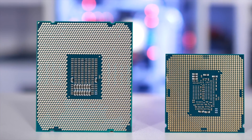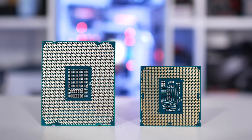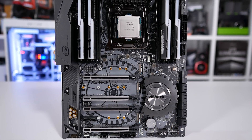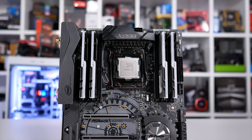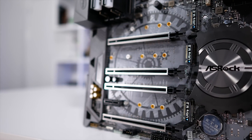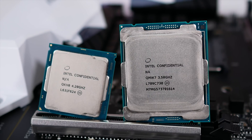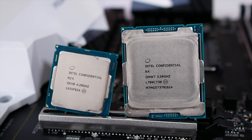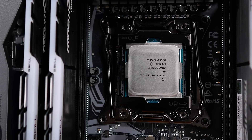Of course, there have been some other major changes to the Skylake X architecture, so it's really difficult to say for sure if it's just the mesh design that's responsible for the weaker than expected gaming performance. In any case, what we're now seeing is much similar performance between processors such as the Core i7 7800X and the Ryzen 5 1600 — both of those processors are, of course, 6-core parts. Intel still does have an IPC advantage, but it's nowhere near like what we saw when comparing the Core i7 7700K to, say, the Ryzen 5 1500X at the same clock speeds. I believe that while the mesh design might work well for high core count CPUs — those exceeding 12 cores or thereabouts — it doesn't really work that well for lower core count CPUs.